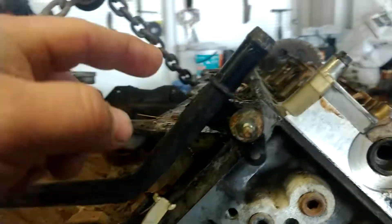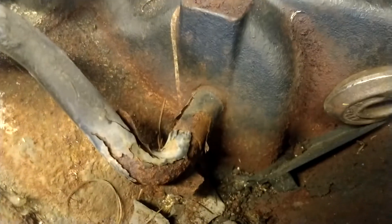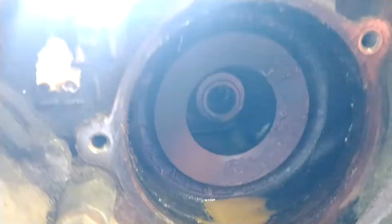This one bolts on the top side and the arch goes lower across here than the other one. I hope that doesn't make a difference because this one is incredibly rusted — it is driven into the block. It's gonna be a nightmare if I have to change that. I've got the water pump pulled out of this one; that looks good right there. It looks like it drives in from the back as a press fit. It has me worried.